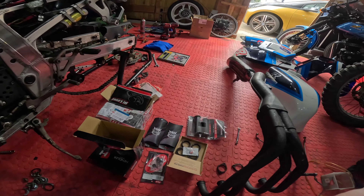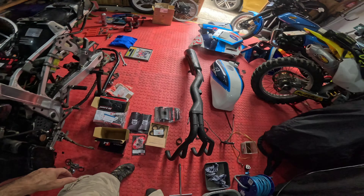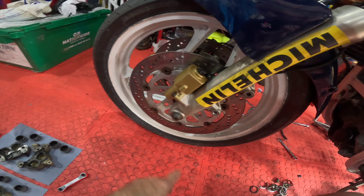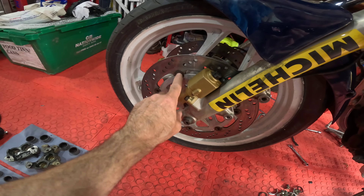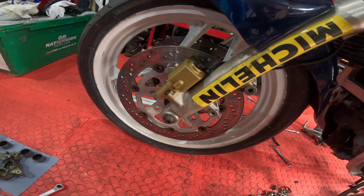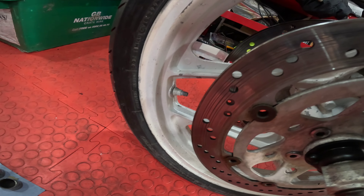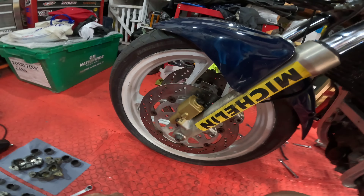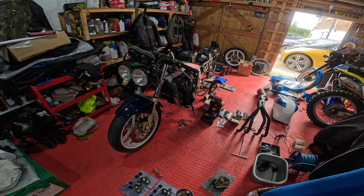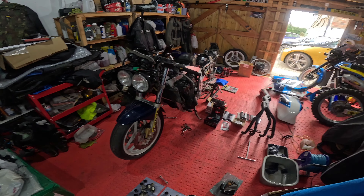Unfortunately I've got to go to work today, but maybe next week I'll start bolting the bits back on. Brake calipers first, get the front end done, get the fork seals done, get the wheel out, check the discs, check all the bobbins, check the wheel bearings - it needs a new front tyre. I'm going to paint the wheels black because someone's painted them already and didn't even mask the valve off - that sort of thing annoys me. Anyway, I'll catch you soon for the next update - hopefully it should be looking a bit better than it does now. Take care everyone, catch you later.